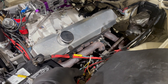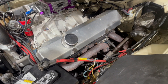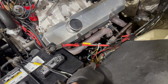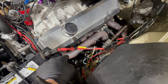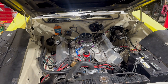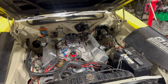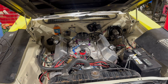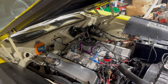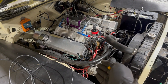That charge output then runs back through the firewall connector, through this red wire on the E-body, over to a contact point on the starter relay. The position of that relay will vary based on body style — on earlier B-bodies and A-bodies it's over on the firewall. This is used as a power point; it connects to battery positive through a small wire like this, or through a wire that comes up from the starter. So just to visualize the issue: charge from your alternator has to run through 1, 2, 3, 4, 5, maybe 6 connection points to reach the battery. Every one of those connection points is an opportunity for circuit degradation, increased resistance, generation of heat, and loss of charge coming from the alternator to the battery.